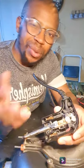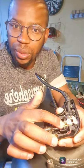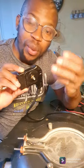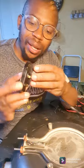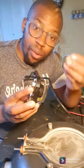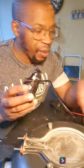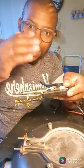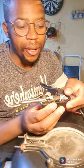Here's the plate that changes shape depending on the temperature. If you can hear the clicking sound — when it comes up to a certain temperature it clicks open and closes. But it depends how much you push it using your scroll knob at the back. If you push it very hard it will only close at a very high temperature; if you put it very low it will only close at a very low temperature.